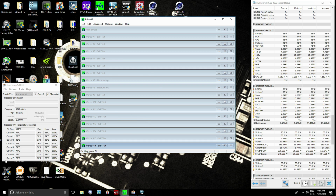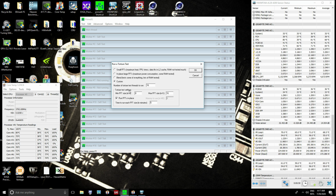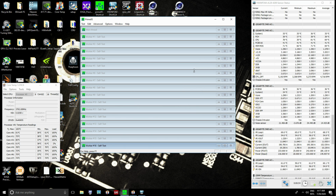82. So I'm going to start moving the mouse now, and we immediately lost core 3. So core 3 is again extremely upset, right? As soon as I started moving the mouse around, core 3 just went like, nope, we're not doing this. I'm done with this. I'm not running Prime 95 anymore. So I'm not gonna touch the mouse now. I'm gonna let it get up to 85 degrees, and then I'm gonna move the mouse. In theory, I would expect that to just hard lock the system at this point, but this motherboard has so far not failed to disappoint me with its ability to crash.